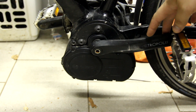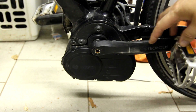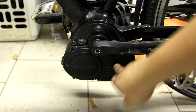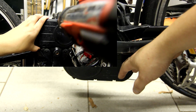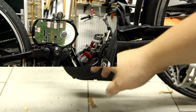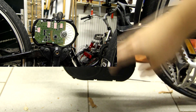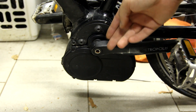This bike has what's colloquially known as the second generation Bosch mid-drive. There's a motor here — a brushless DC motor, not super big, roughly as big as your hand — and a reduction gear set which is actually nylon. I was riding on nylon in my other e-bike motor video, but Bosch uses it too. And then there's a clutch system here that drives the actual crank.